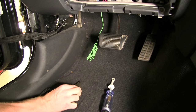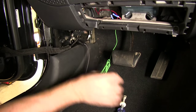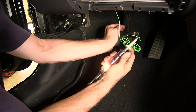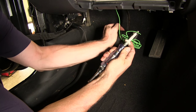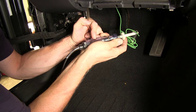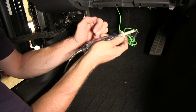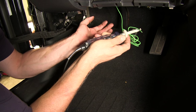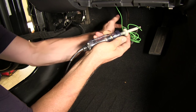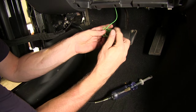We'll test it with a test light on our green wire. We'll take our tester, clamp it to the ground on the side here, probe the wire, and push the brake pedal. So our test light is basically replacing, for now, our indicator light from our supplemental braking system. This signal could be sent up to a light that's inside the vehicle or maybe to a monitor cable that's ran up to the RV. If everything works, we'll take a moment to bundle up our wires and make sure it's safe, secure, and out of the way. This is ready for its upgrade to the supplemental braking system at a later date.